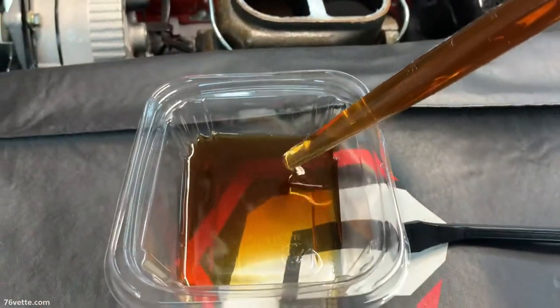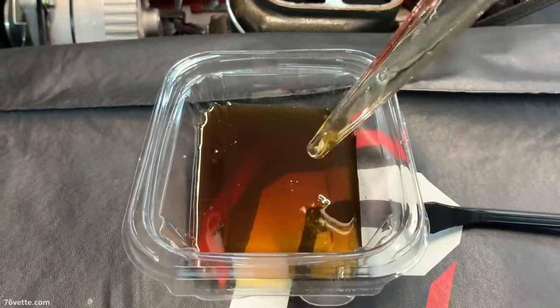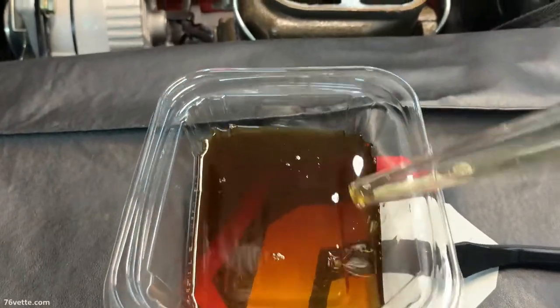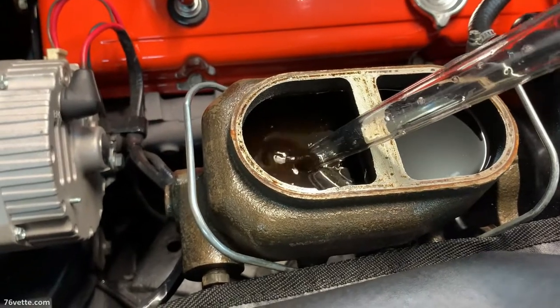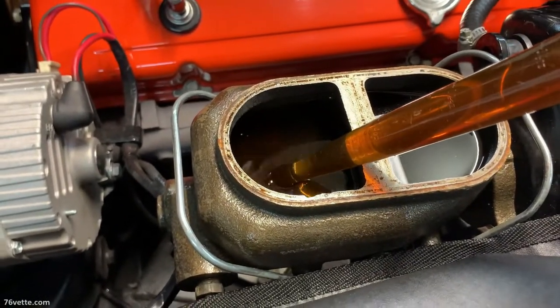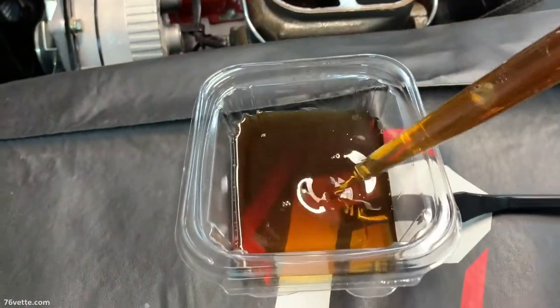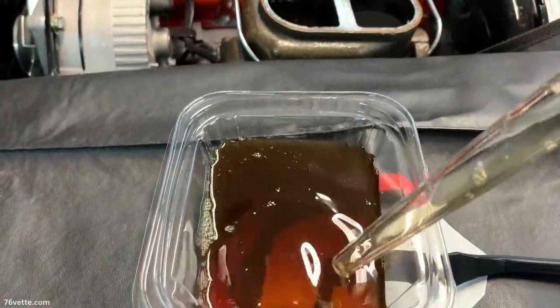As a side note, I prefer to leave some brake fluid in the reservoir just in case I get distracted and for whatever reason I pump the brake pedal — that is how air can get into the system. The process I am showing you will not do that, and you could safely remove most of the fluid from the master cylinder. Having said that, this is not a flushing of the brake system. I am just replacing some of the fluid.